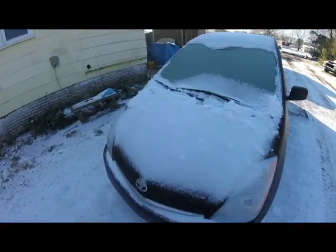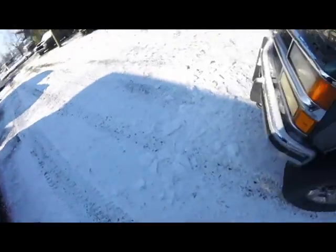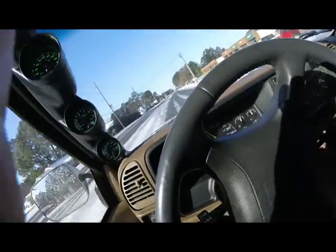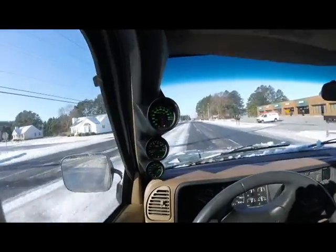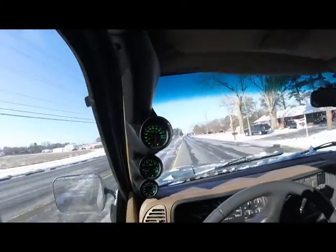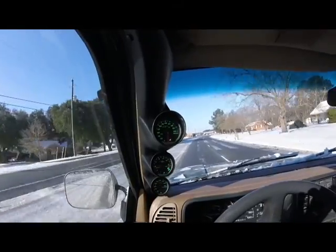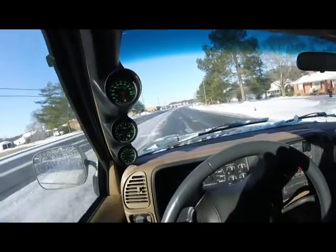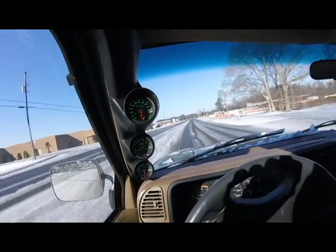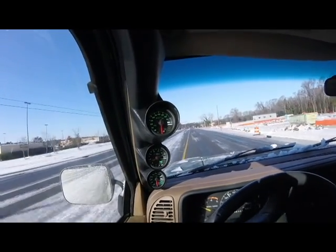Shoutout to Yankee Prepper — this is my hippie mobile, hope you don't start hating on me. Pretty happy with this truck. The most boost I've gotten was 12 pounds, which is exactly where I want to be — I didn't want to go more than 15. I'm using the original wastegate, which I believe is set to 20 pounds. The tune is essentially what dictates how much boost I'm going to see.